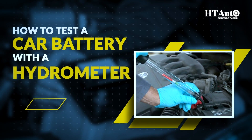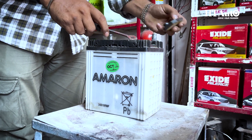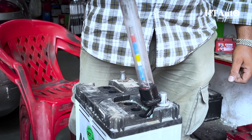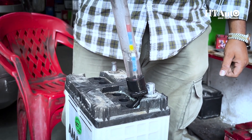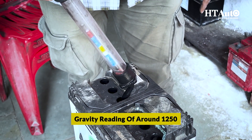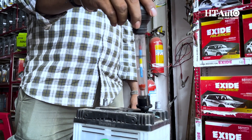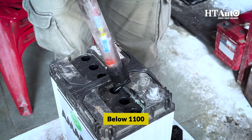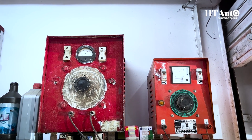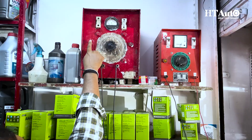The second and older way to check if your battery is discharged is with the hydrometer. For this, carefully open the battery covers and insert the hydrometer in all the cells one by one. If the battery is fully charged, the hydrometer should show a gravity reading of 1250, indicating that it has enough energy to power your car. If the reading is below 1100, then the battery is discharged and you will need to charge it up before you can use it again. Do check with your local garage for the right numbers, as they vary from car to car.